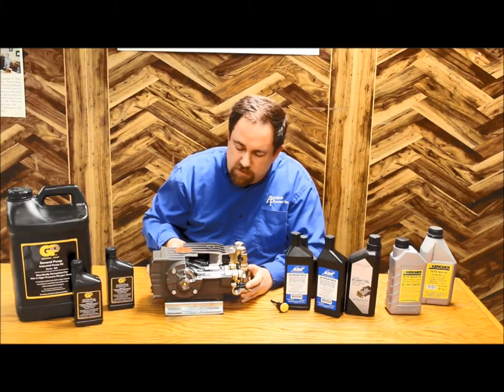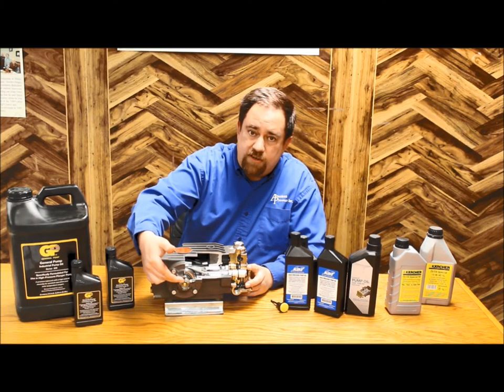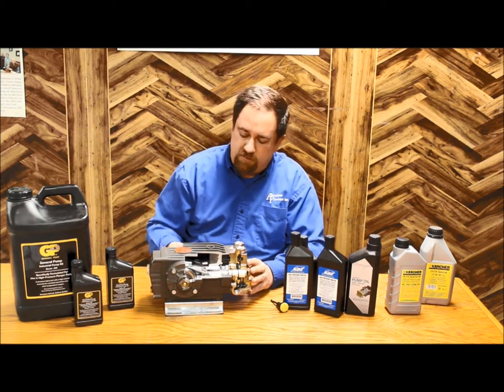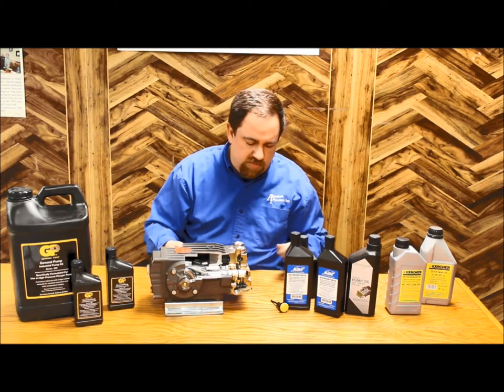The ideal pump level is to the sight glass dot, or just a little bit submerged if your rotation is in the opposite direction. You can look at a gas engine to see which way things are turning to make that determination. But when we're going forward here, we need a little more oil — we want the splash. You've got to maintain the splash.